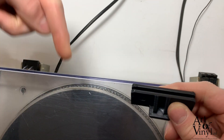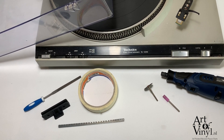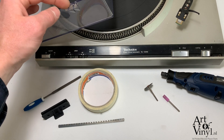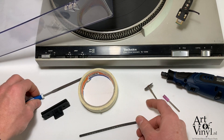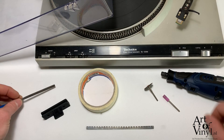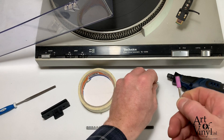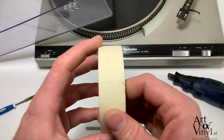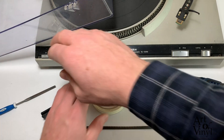The link to this particular product you can find down below in the description of this video. In order to execute this repair we'll need a couple of things. First we'll start by taking off the old piece of hinge, so for that we'll need some abrasive material. You can either use a saw and file — first saw it off and then file it down flush — or you can use an electric multi-tool with a grinding disc and an abrasive stone to make it smooth. I would highly recommend using masking tape on the pieces you're not going to grind down so the dust cover retains its nice smooth surface.